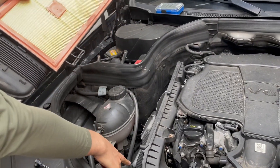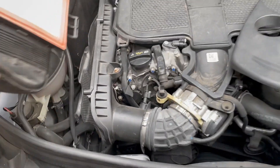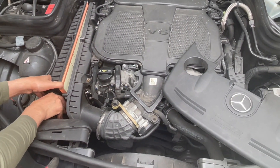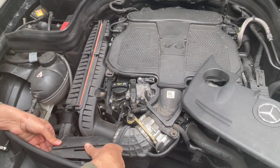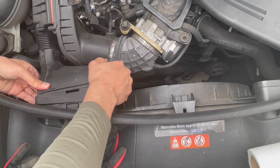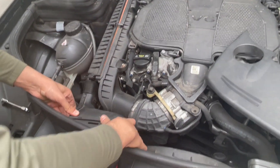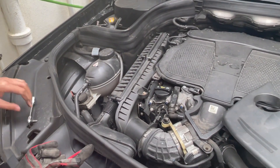These hooks have to go in front — not behind — they slot in front. It's easier to feel than to see, so wiggle it into place. Then put this snorkel part of the air filter housing back on, again just wiggle it in place. Once that's in, the three screws go back in — pretty self-explanatory. And that's how you change the air filter on the newer GLK 350 engines.